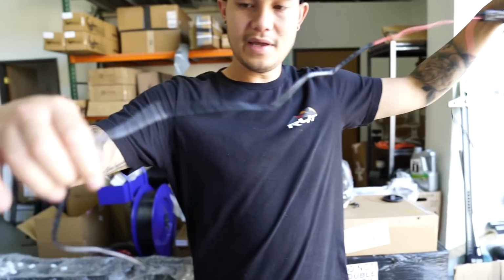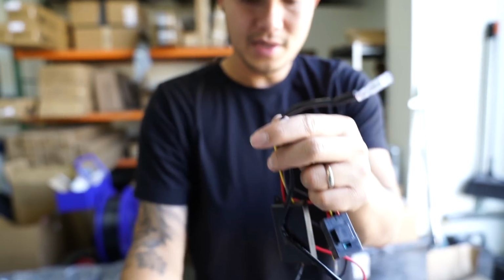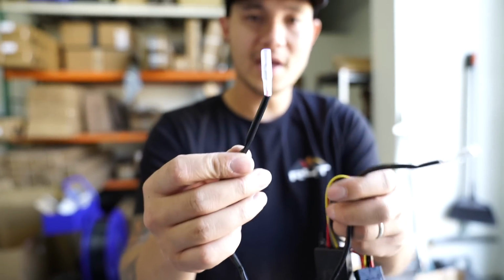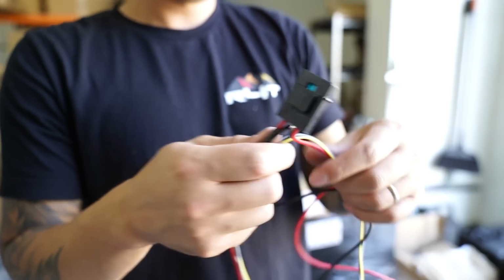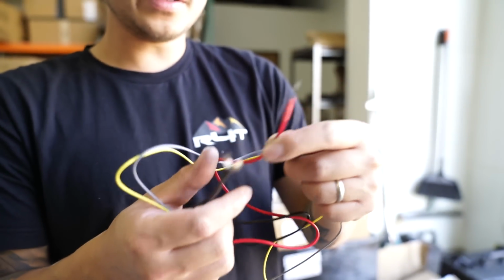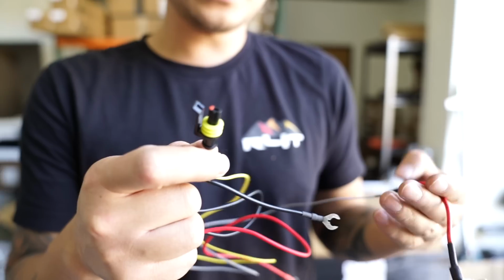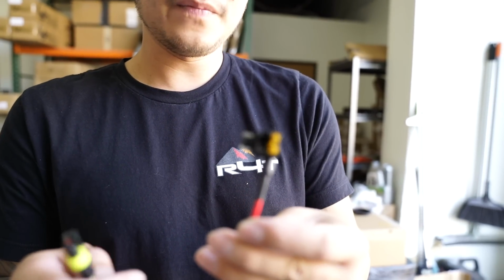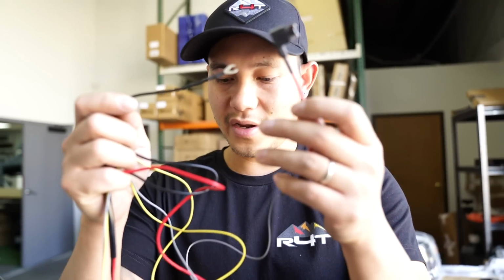On one side is going to have a long cord with this little clear piece on the end of it, and it has like a little butt connector. On the same side, it's going to have a shorter one. So put the shorter one on the driver's side, and the longer one on the passenger side, okay? And on the other side of the module, it's going to have a little fuse holder, a black negative ground terminal, a red positive terminal, a little yellow wire with a yellow grommet or rubber piece, and lastly the added fuse. You will need to put a fuse in here depending on what you pull out from the fuse box though. So if you have an SR5 SR model, this is all you will need, okay?